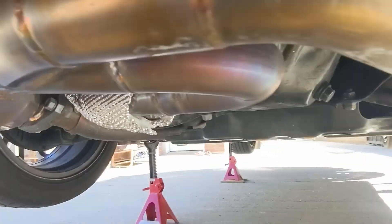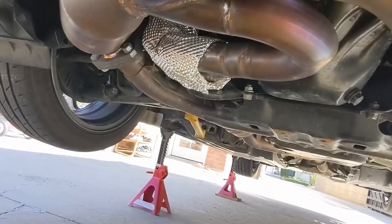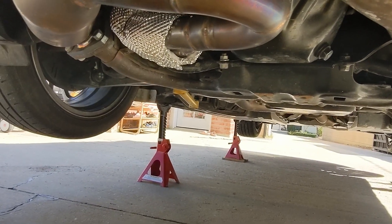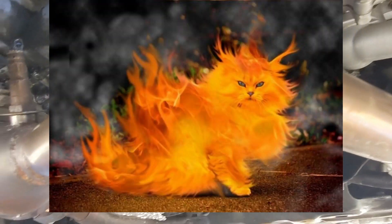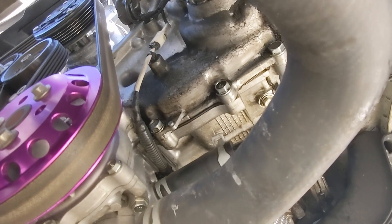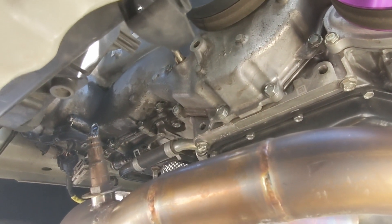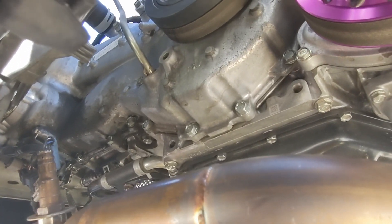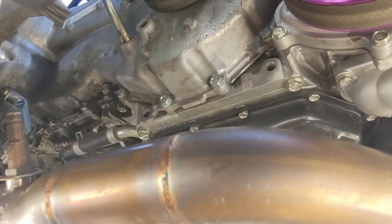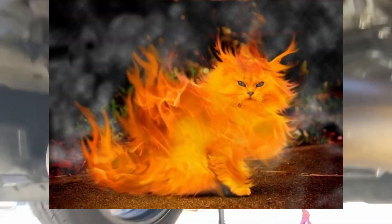The timing cover is made out of aluminum — I think it's just cast. The OEM exhaust manifold had a heat shield above here, but I haven't been running a heat shield for the past couple months since I installed this header, and I feel like there's a lot of radiant heat just rising up. It's like a heating element, basically an oven going upwards — convection and radiant heat. The weeping problem wasn't so bad before, but with all those high RPMs there's a lot of vibration, and with vibration there's a lot of heat cycles — hot to cold, cold to hot — and then sustained heat like cooking. That timing cover is getting hot and cold, hot and cold, rapidly expanding and rapidly cooling at night, especially with a really hot exhaust manifold right under it.